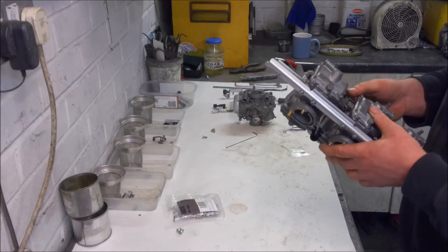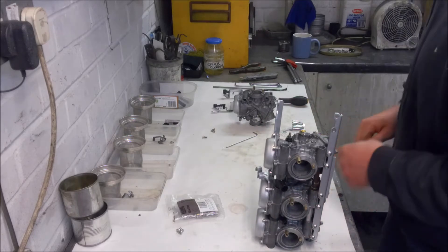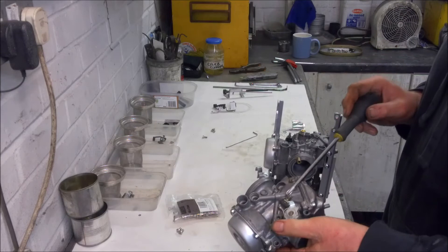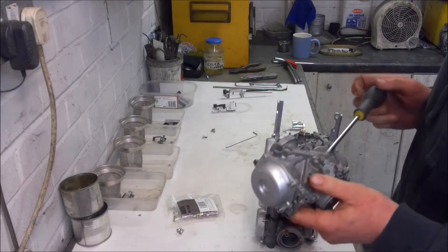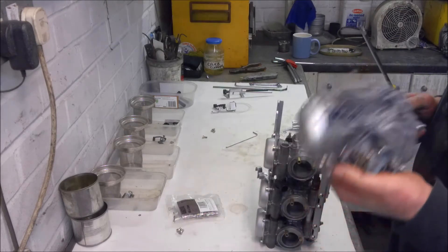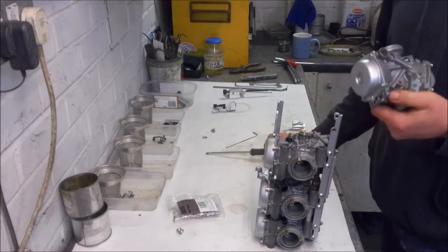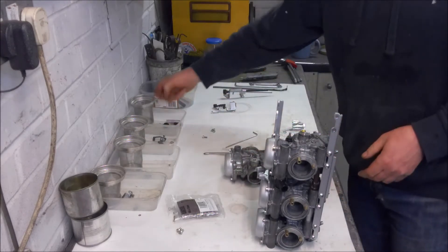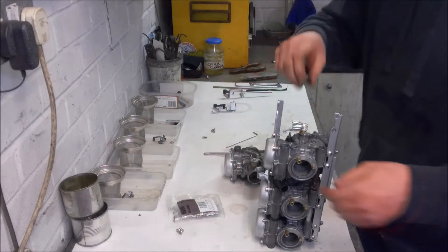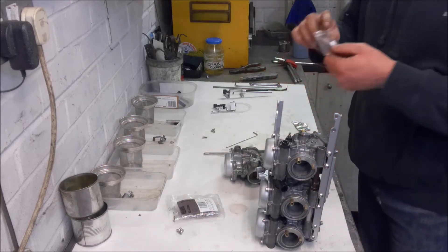The rails are just on loosely and now we'll put the final carb on. Before putting the carbs together, what I tend to do is back the adjusting screw off all the way out - you'll see that makes life a lot easier a bit later on when we come to put the spring in the top. There's the spring, put the little cap up here, and then we've got the last few O-rings to fit. The nice thing with the Lytec kit is all the o-rings are numbered and there's a little diagram on his website showing which o-rings go where, but to be honest it's fairly obvious. Just a little bit of red rubber grease on those to lubricate them up, and it should just nicely slide into place.